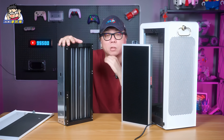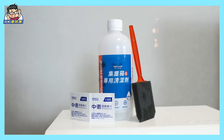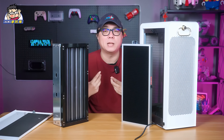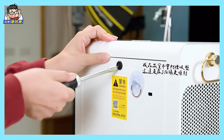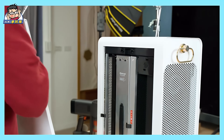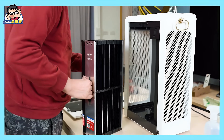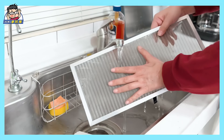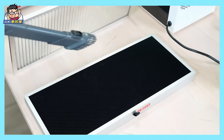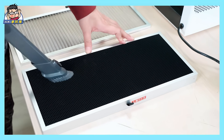Here Ahoy will demonstrate the cleaning process for everyone's reference. It's completely zero consumables — no need to purchase expensive consumables. The only thing you need to prepare is some cleaning tools. I personally prefer using a handheld vacuum cleaner. Remember, before you clean, unplug the power source first, then prepare a neutral cleaning agent — the neutral dishwashing liquid is the simplest choice. It's recommended to use gloves, a brush, a screwdriver, and alcohol wipes. First, there's a panel on which you need a screwdriver or a coin to open the door panel. Stepwise, remove the multi-layer filter core, including the pre-filter mesh, then the dust collection box and its precious metal conversion plate. Use your vacuum cleaner to clean the inside slightly. Next, for the pre-filter mesh, if it has accumulated a lot of dirt, it can be submerged in water for enhanced cleaning. The precious metal conversion plate — make sure to vacuum both sides. You can place them under sunlight to air out, but do not expose them for too long — just about one to two hours is sufficient.